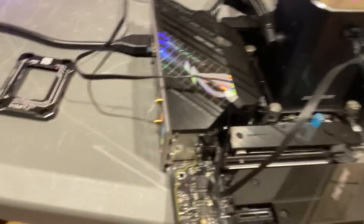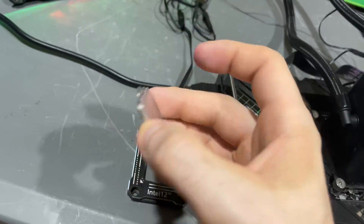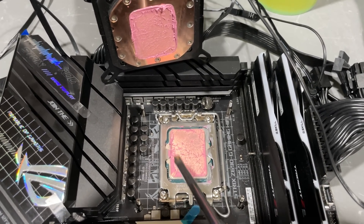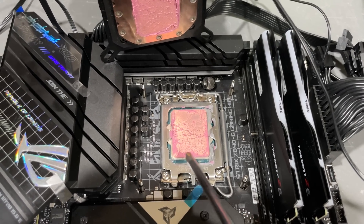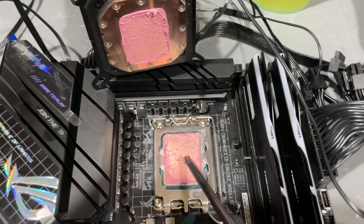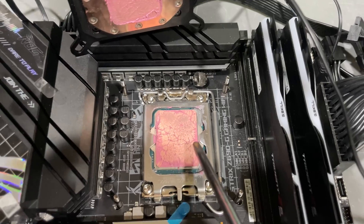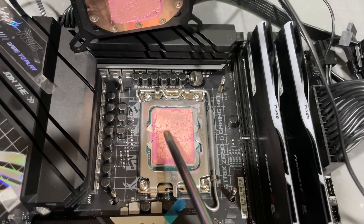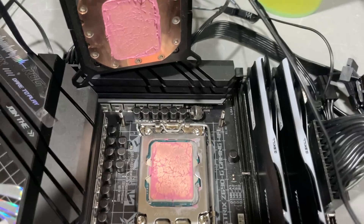I didn't expect that at all. It's strange — this IHS must have had an insane groove in the center of it. You obviously can't see it, but yeah, this has now become an IHS lapping video because those results are insane. Here's the paste spread on this one — this actually looks much better. The paste collection on the outside here just means I did a messy lap job; the sandpaper was scraping more on this side, meaning the sandpaper wasn't flat. But you can tell on the inside the paste kind of pushed out. The latching mechanism — maybe just a bit in the center here, there's a little bit of a pool. I would argue that overall, the center being the contact point now is where that temperature reduction came from. Let's install this bad boy now and see if it gets even further.